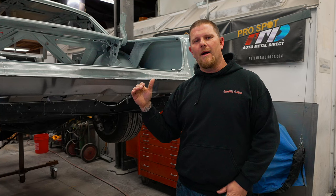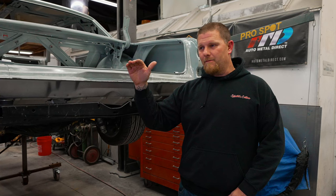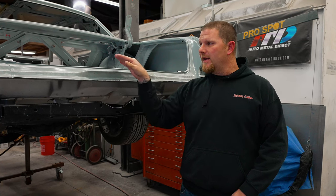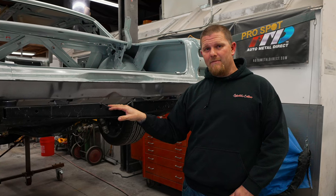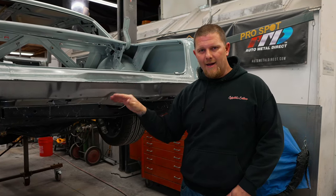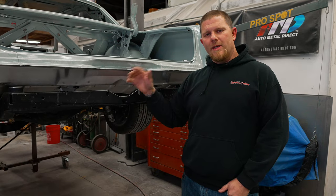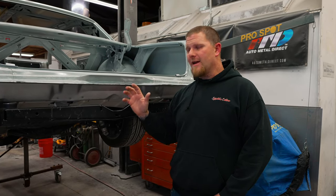People often get hung up on this when they strip their car. Most people know that when we strip a car we acid dip it, and the first question I get is how do you get into all those areas and seal that back up? On a rotisserie with a gun — maybe an angled nozzle — any way you can. But remember that before the car was dipped, all those areas were already surface rusted. We took this body off on a lift — you could do this on jack stands — just make sure it's secured safely so it's not going to fall on you.